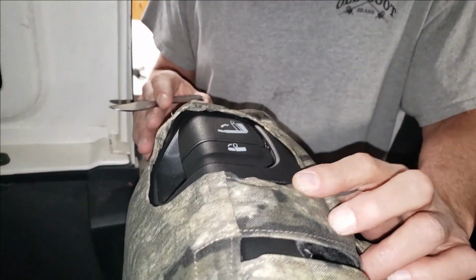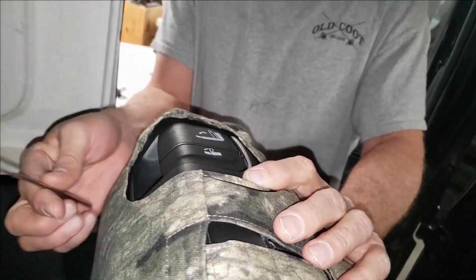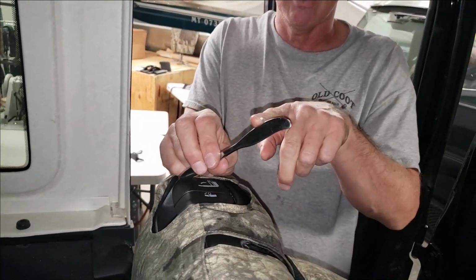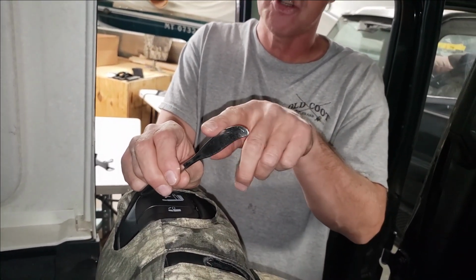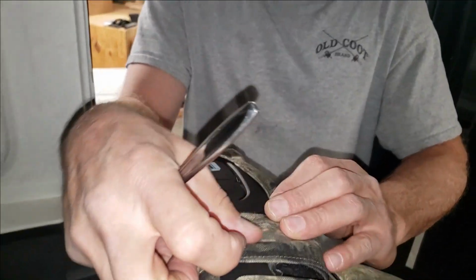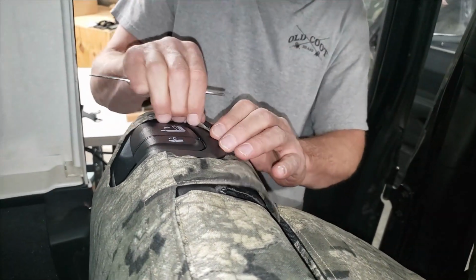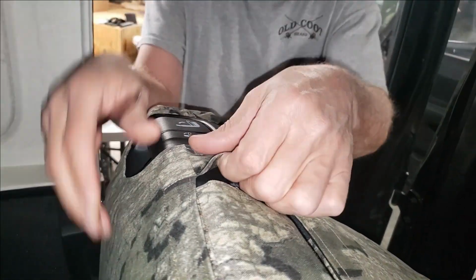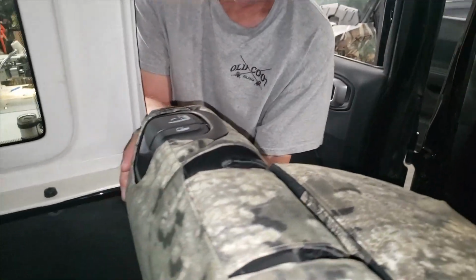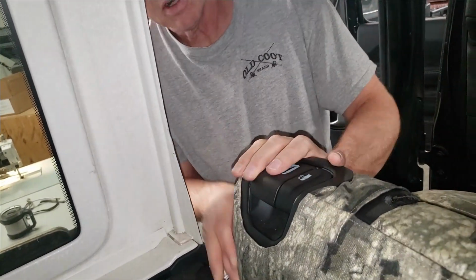Next, we're going to tuck the seat cover underneath the plastic for this latch. Use a real specialized tool here: a common butter knife. The big feature with this one is there's no serration. You don't want any teeth on there as you're tucking, but they just work perfect for tucking covers in under plastic. So I'll work this along the front edge here. All the while I've got to pull down on that seat cover and tighten that up a little bit.